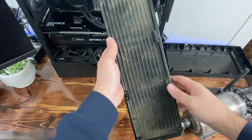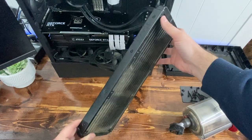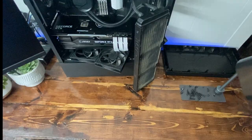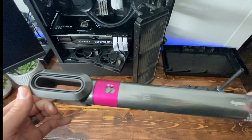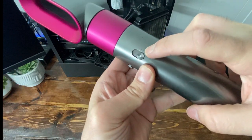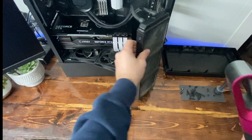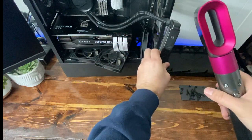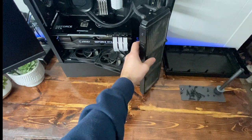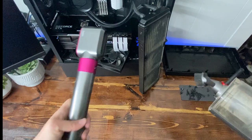As you can see, that did not get everything — there's still a lot of stuff in this radiator. So the next step: do not tell your wife you're going to use her blow dryer, but set it on cool at max. We're going to go on the back side, because the bulk of the dust is on the front side, and blow towards the dirty side. Then we'll vacuum on the dirty side while blowing from the back.